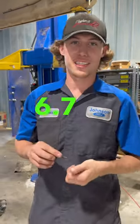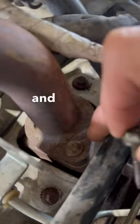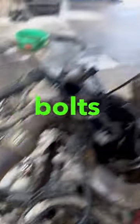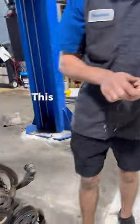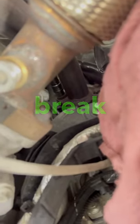The most aggravating thing about the 6.7 Power Stroke is these little 8mm bolts that go through this EGR feed pipe and into the exhaust manifold — the same bolt that feeds into the EGR valve. Unfortunately, these bolts are made out of titanium, so they are not magnetic — see, the magnet does not stick to the titanium. This thing will seize up in the exhaust manifold because of all the heat, seize up and break off.